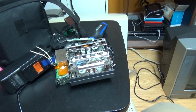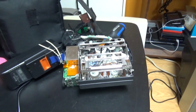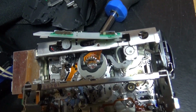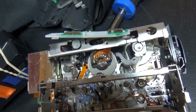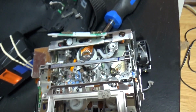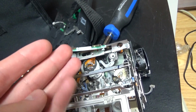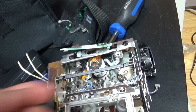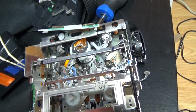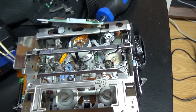and also most 8mm camcorders and VCRs have an auto head cleaner that works pretty much like VHS. And mini DV camcorders also have an auto head cleaner like this, like the JVC mini DV also has one like this, and you can also hear the auto head cleaner when the tape is loading, and it just goes tack tack like that while the tape guides are moving forward. But this one does not work like this.